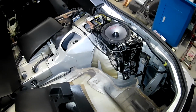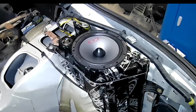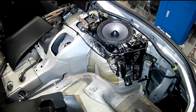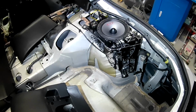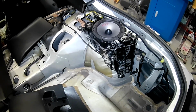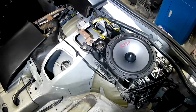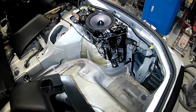We are, of course, replacing another pair of those really cheap and nasty Pioneer dual cones that we saw in the front setup. There's another set of those in the back. Pretty dodgy job on the wiring. It still had the factory Bose amplifiers in there. They've all been stripped out now. There's no point having crap in the car that's not being used for anything. All the speaker wiring's been replaced through the whole vehicle. You can see we've got lighter stuff there and heavier stuff running all the way through the main parts of the vehicle. So that's how it's going so far.